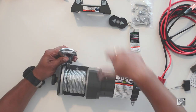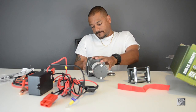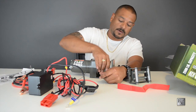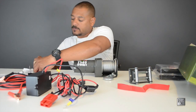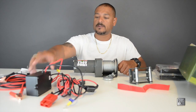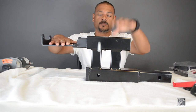Here you have your hook with a safety latch, your negative and your positive. You're able to pull out and turn to freewheel — it's got little ears on it that let you freewheel it in both directions. You just pull out and let it sink back in to lock. I'm going to go get the winch mount bracket that's going in the back of my hitch receiver, and we'll mount this, hook up the wiring, and give it a test. The bracket came from Amazon, and both pieces come separately.